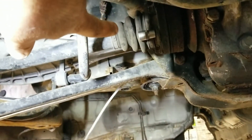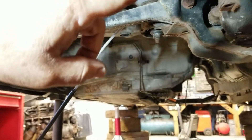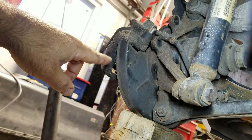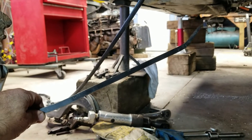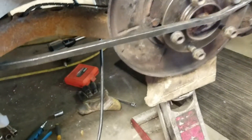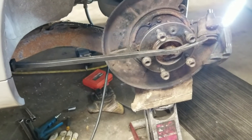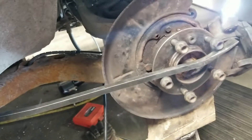I've put the jack under the rear suspension just to lift it up a bit, just to give me more clearance to get this socket into that bolt. You may need to lock the shaft in place because now with the drive shaft off, this is going to spin freely. Normally it would be in park and this wouldn't move, but I might have to lock it somewhere — put the bolts back into the hub and lock it with something just to stop it from moving around. There's a long bar and it's jammed underneath the body of the car.